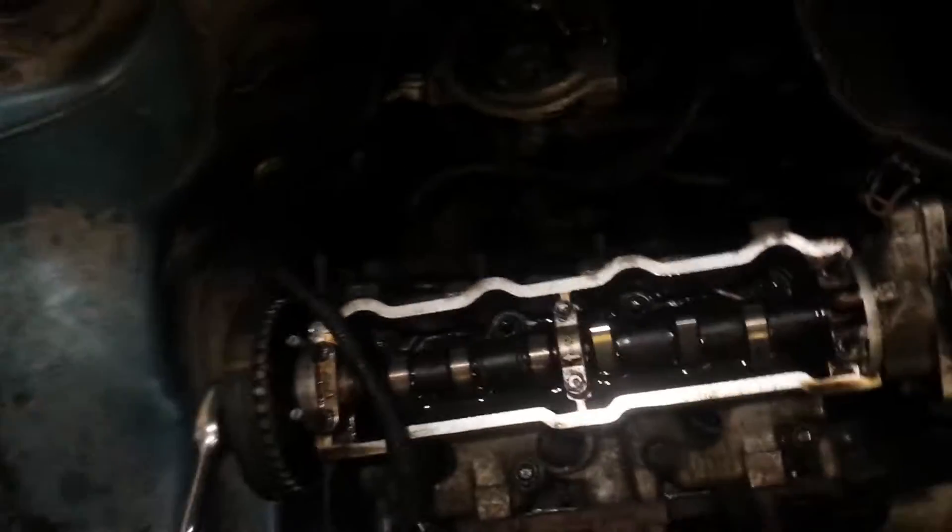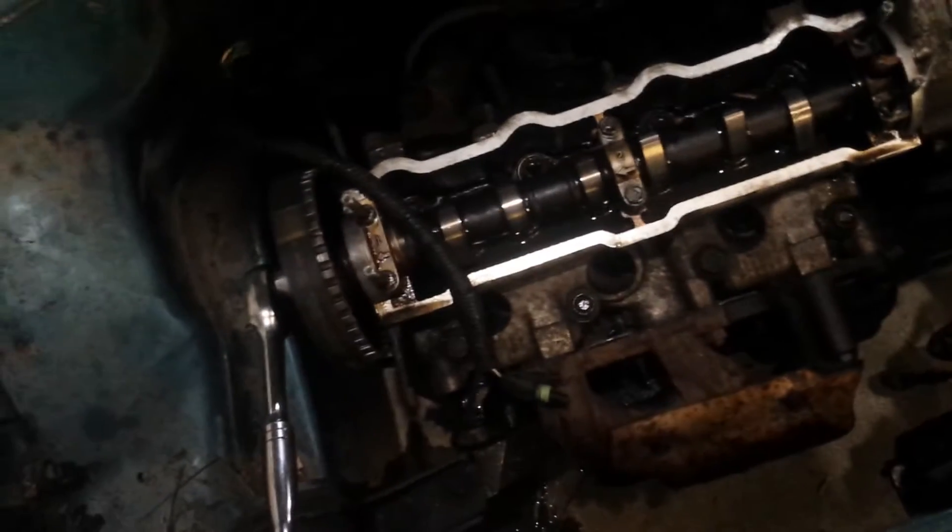We got her, finally. She's just in the putting-back-together process. I'm going ahead with that cam bearing anyway — it's not going to hurt nothing. I took a wire brush and went in there and took a little spinny sander and smoothed out the inside of the cam journals.